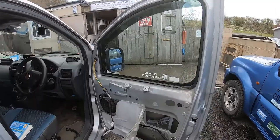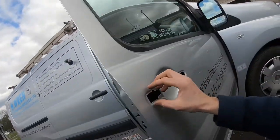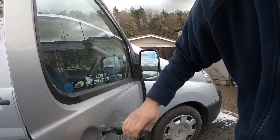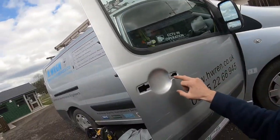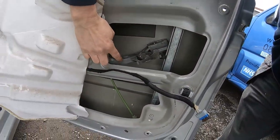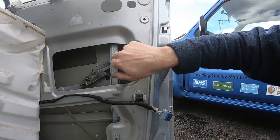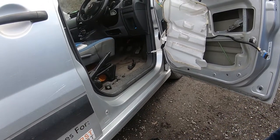So that's the main latch out — probably the most awkward bit was just getting the door handle off. Undo the stud that was there, which then takes that push-button lock out, then the handle slid forward. This plastic bit slid back — it was in like that, it slid back — and then that all came out. Then there was one screw just there, had to take that out, which then released all this door handle out, which is now just inside there. Now I think the problem would be getting that out, so I'm just going to leave that in position. We've got to try and remember which way the cable fed around so it doesn't get tangled. Just got to disconnect it from that pull handle, and then we'll start putting the new one back in.